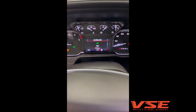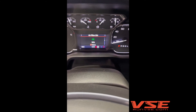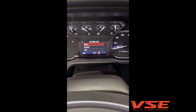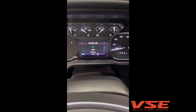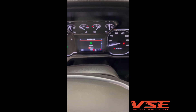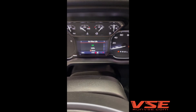This truck is different — we've had it tuned for quite a while. On these trucks with down-level dashes, meaning the truck isn't quite as loaded, you can literally toggle over using the steering wheel button and reset the dash message if it were to pop up after an ECM replacement. You just hit reset and it clears the message. In this case the message isn't present because this truck has been tuned since about 30 miles and there's almost 2,000 on it now — it was reset right after we replaced the ECM.